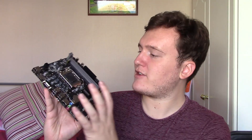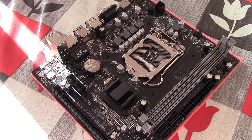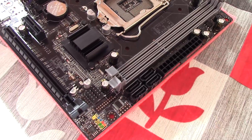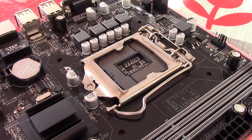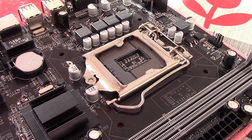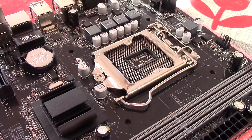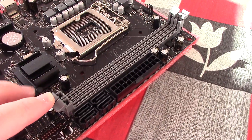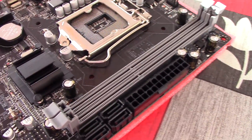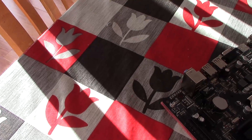This thing is actually really nice. It looks the part, but that means nothing if it doesn't work. Let's start with the processor support — this is an H61 board and supports 2nd and 3rd gen 1155 Intel processors, as far as I can tell, according to a few different aftermarket sellers of the product. I'll be testing mine with a 2nd gen i5 a little later on. It seems this supports up to 16GB of RAM, so you can use two 8GB sticks of DDR3. The maximum supported speed isn't immediately stated either, and there was no manual included — just a sheet of paper that labelled each connection on the board.